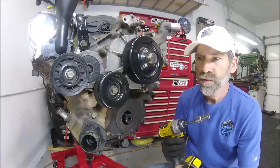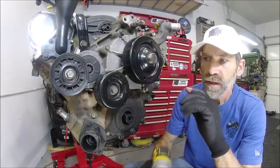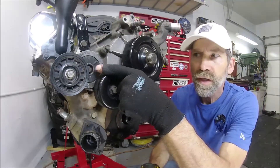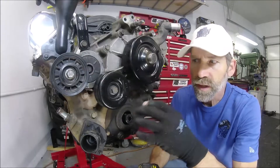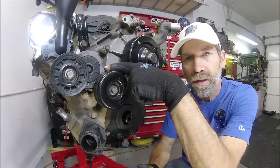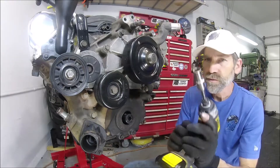Now when it comes to most of the rest of these bolts, it's 13 millimeter. I highly recommend you use a six-point socket because I've heard of a lot of people where they stripped out these bolts, rounded them off — especially this one right here. It gets corrosion behind this tensioner, and that could be a really bad thing. You've got to get this bolt out because there's a bolt behind here that it's covering up that you need to get to. So, six-point socket.